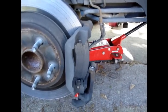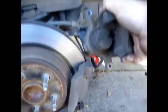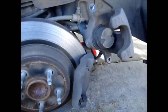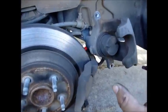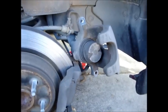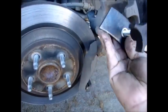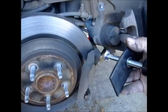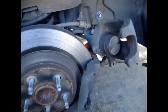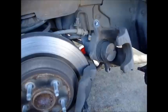Once you get to this point, there's always the dreaded issue of pushing the piston back into the caliper in order to get the brake pads to fit. This is my first experience with this type of caliper. I'm used to using the compressor that you put on the front and just slide it in and push it down. Well, when I was pushing it down it would bottom out and wouldn't go anywhere. Through some research I found that you actually have to turn this to make it go down, kind of like the import vehicles.